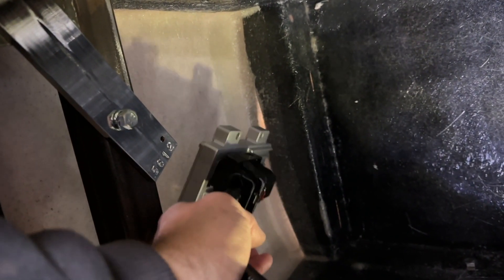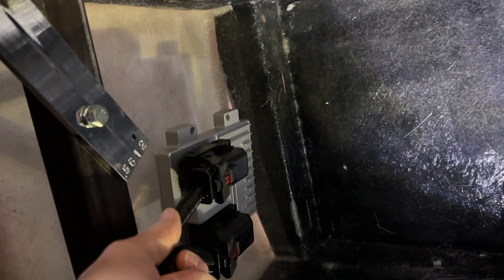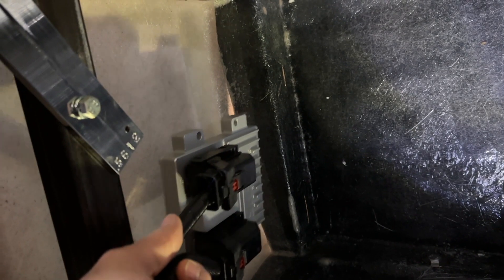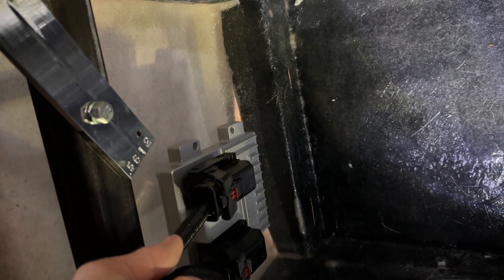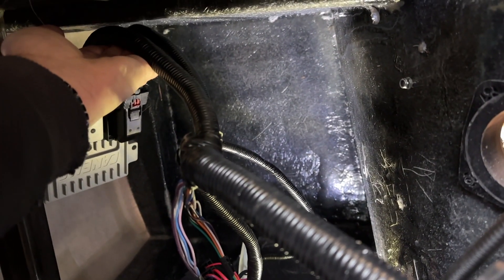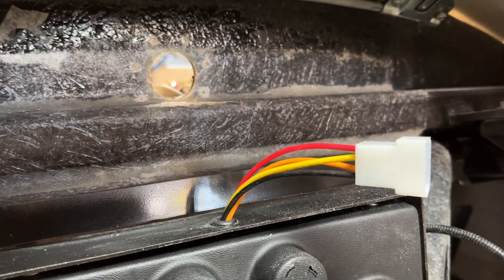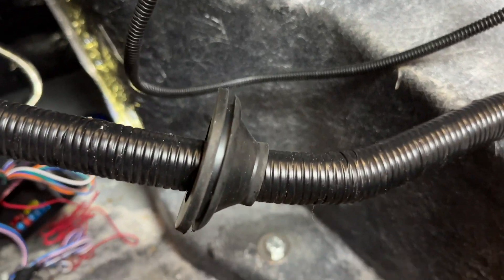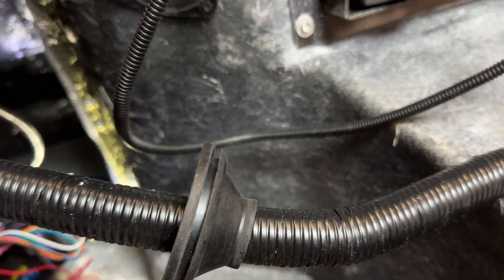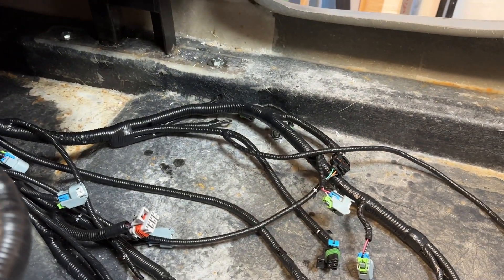I'm thinking I could sink this in here. Obviously I can't fix against the skin of the body, so I'm thinking of making up some sort of bracket between the back and here, then mounting this against the side — possibly in this orientation so the cables go over the top, which is pretty acceptable. I need to check all that and the distances, and where we've got to go with the rest of the loom. I'm going through the hole here, and hopefully I won't need their grommet as I have my own from Trigger Handbrakes.